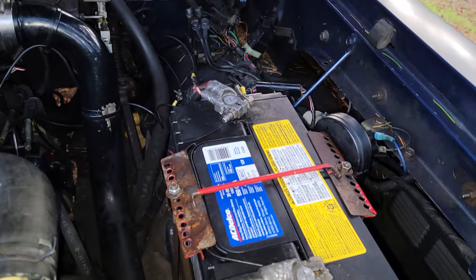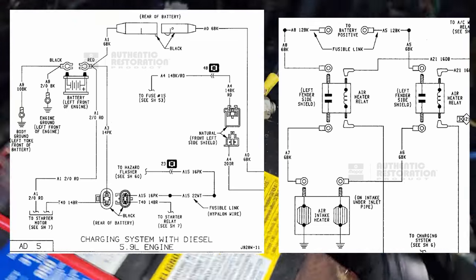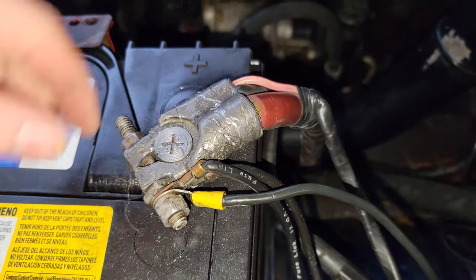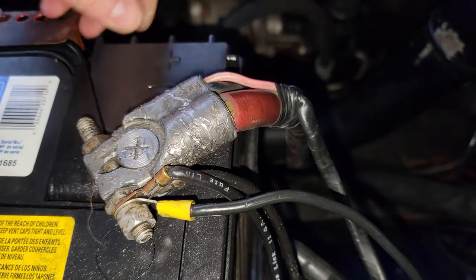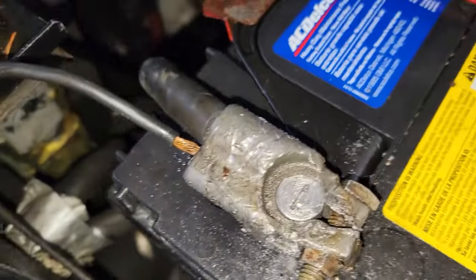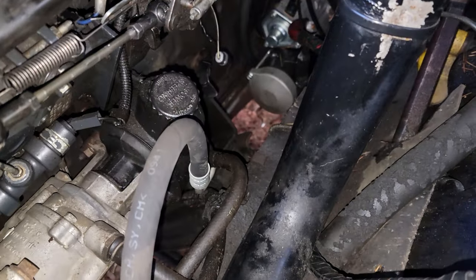You can only imagine over time with the vibrations of the truck that loosening itself on its own — more reason to be doing these terminal upgrades. I'll throw up the factory wiring diagram to show you what everything is wired to from the factory. There's only one non-factory wire, going down to the trailer brake controller. The factory wiring consists of: the two-gauge wire to the starter, a pink wire to your hazards, a thicker black wire to your fusible links, two fusible links to your grid heaters, and on the ground side, a chassis ground to the core support and a larger ground to the left side of the engine.